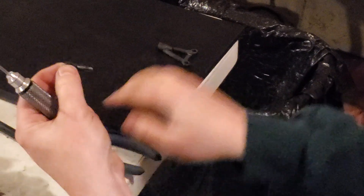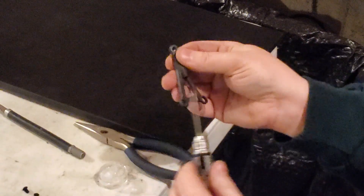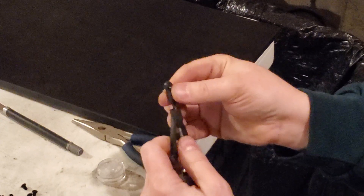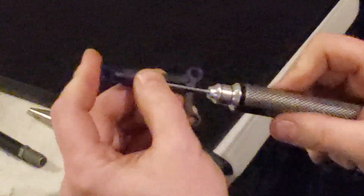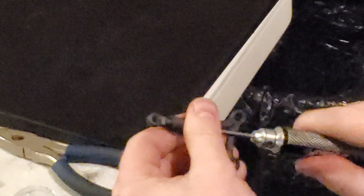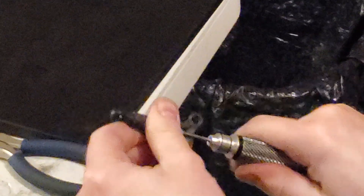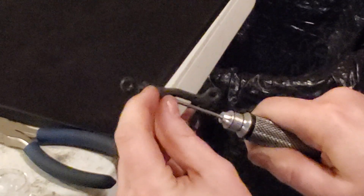So now I've got the ball in and I've got the arm — gonna put it back in, grab it with my 2mm, and then once again reverse thread in. Since this was already threaded it'll willingly pull it in really easy. The idea here is you want to go all the way down until the little dot there is basically starting to go under.